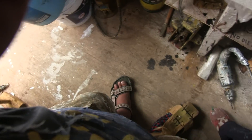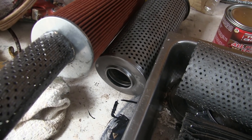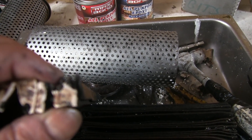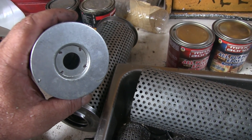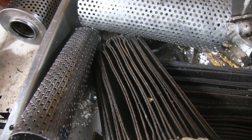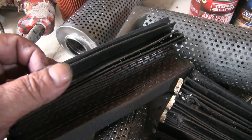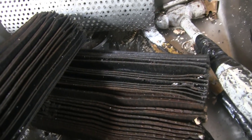I'm going to show you the parts individually. This is the inner tube that the new filter will go around once I pop it out. When you buy a new filter, make sure this paper cartridge is the same width — about five-eighths of an inch. Both of these are for Mitsubishi machines. This is the replacement filter for a similar stainless steel cartridge — right diameter, right width paper filter. The old one, as you can see, is absolutely no good — covered with grease. I've cleaned it once before.